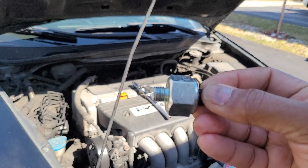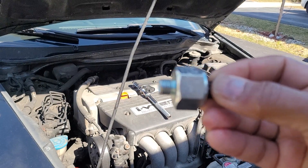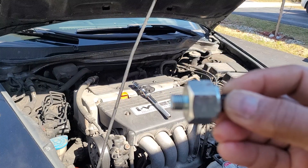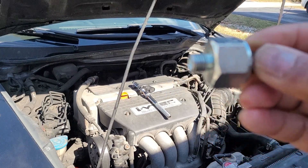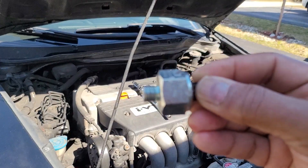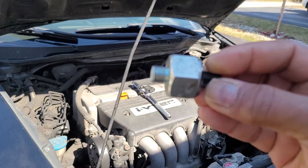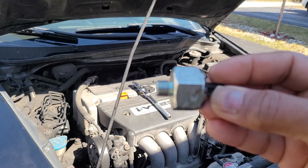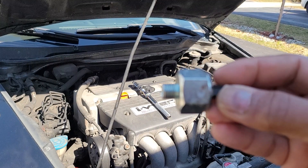So what I did was remove the Delphi sensor and reinstall it using a torque wrench to get the exact 23 foot-pounds. Remember: if you install this at over the specified torque, it becomes super sensitive and will start throwing faulty codes.